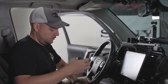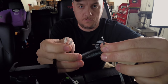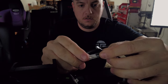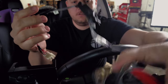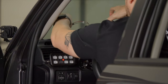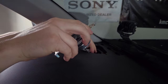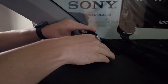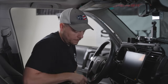Now we're going to work on our wiring. Remove the twist tie from the wires and grab the supplied connector with the crossover. On each connection you have a male and a female spade connector — all we're going to do is match up the connectors and give them a nice little wiggle, making sure the insulation is covering. Once all connected together, go ahead and make your speaker connection — simply push the connector together and do the tug test. Now we're going to gently tuck all of our wires back into the dash, making sure they're not going to obstruct the connection points and that we don't put screws through our new speaker wires.